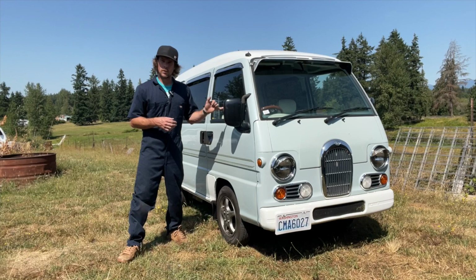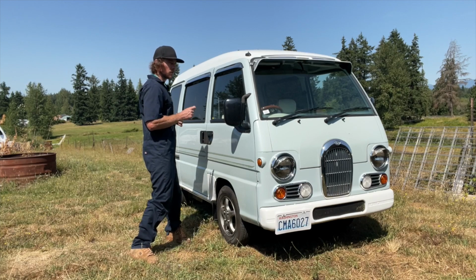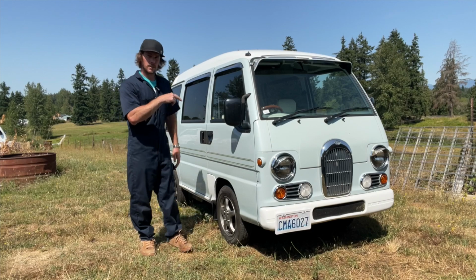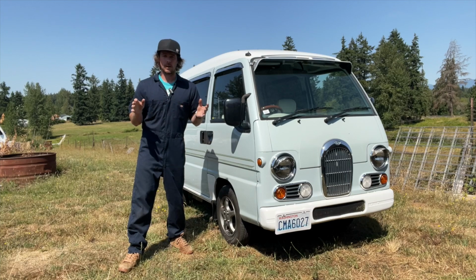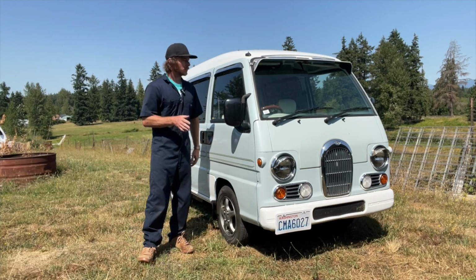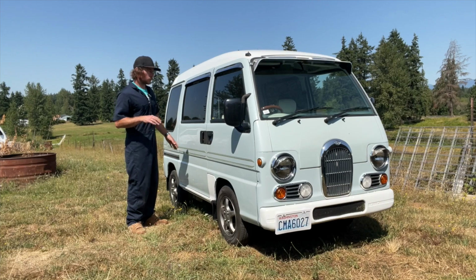I did a steering wheel. I'll show that. I did front rotors and pads because the old ones, I think they were at the minimum thickness and the pads were shot. Obviously did an oil change, air filter change. It looked like they had done a fuel pump and fuel filter in Japan fairly recently because it was the only thing that was not rusty and it was clean, so it looked brand new. So we didn't do a fuel filter. It wasn't necessary. It didn't need it. But some stuff will come to my mind. Oh, and I did shift bushings.